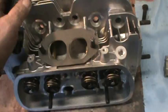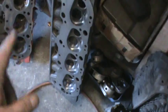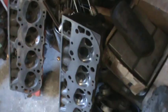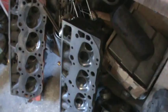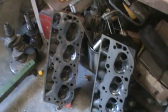Here's another set of heads I wanted to show Mark — some CNC heads I bought. That's the finish they put on the intake ports: CNC ported and dusted up with an 80-grit drum. This is the finish you'd see on a set of professional heads. I think you were on the right track with what you were doing. The main thing is the bowl area — the more you can uncover that valve and unshroud it in the combustion chamber, the more power you're going to make. The important part is the under-seat area. You can usually get somebody to run a bowl hog through a head for around $100, which is cheaper than grinding by hand — and definitely worth it for the performance gain.